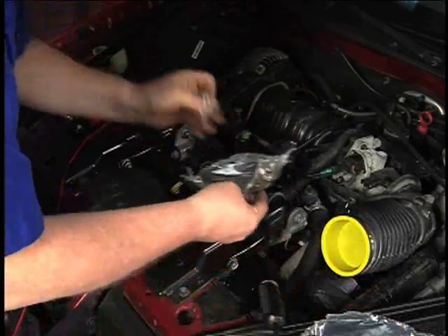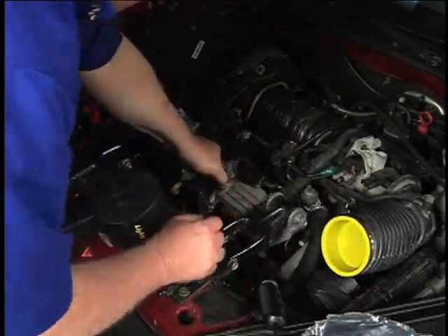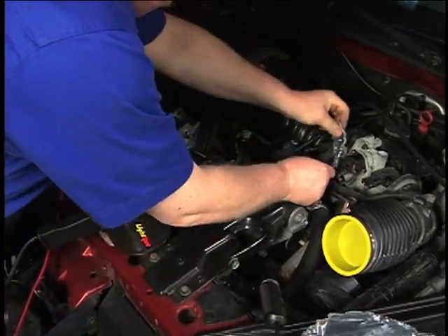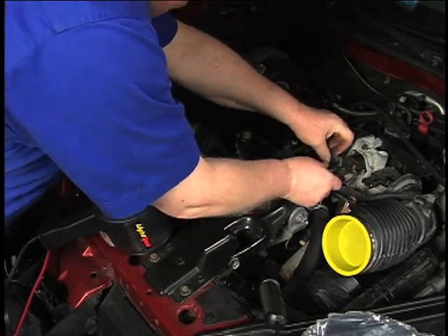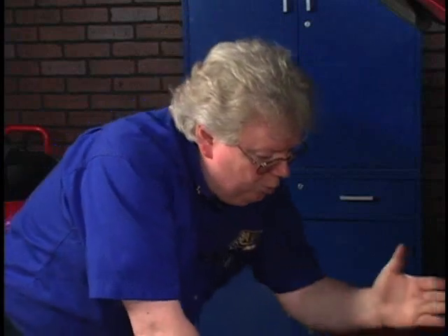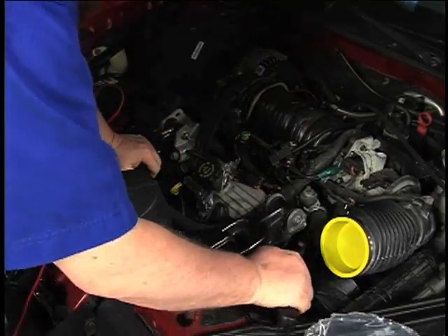Take some simple rubbery plastic — I don't care what you use — just take some small pieces and stick them down in the holes where you know the leaks are. Here's a small piece for our manifold fitting. Let's roll the smoke again. We're going to buy a part here and a part there — let's see if we need anything else. Smoke's rolling, let's get the bright light on.